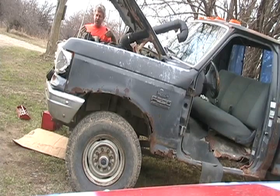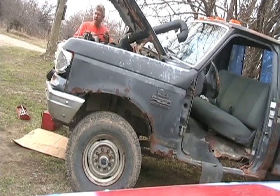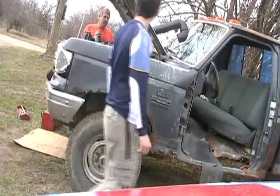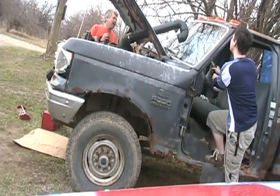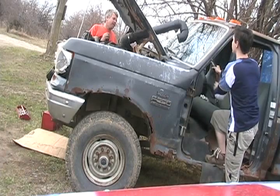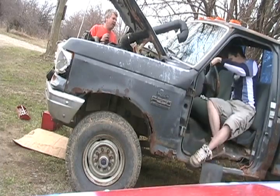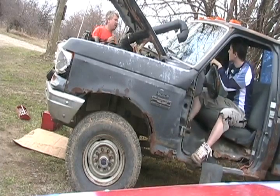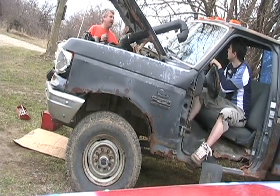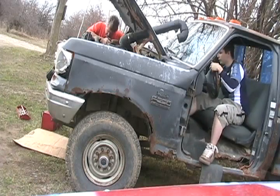You have to go in there and turn the key. Is the key on? Turn it on. On the right you'll see a little red light that says 'please wait.' As soon as that light goes out, hold your foot down halfway on the gas and crank it until it starts. If it doesn't start, I'll tell you to stop, wait, and try again. Once it starts, it won't keep idling by itself — you have to hold it at about 1500 RPM. Turn the key on and tell me when the light goes off. Light's off — go ahead.